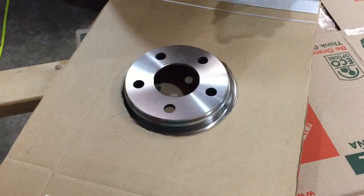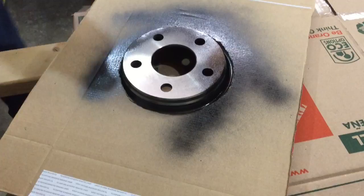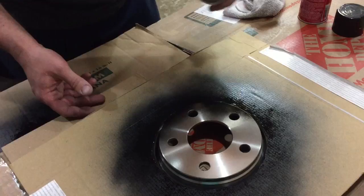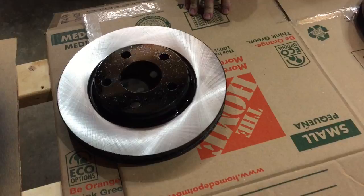The edges are painted with two coats. Now we'll lay our template right over the top of the rotor and start spraying the hubs. We've got one coat on the first rotor, so we've moved over to the second. A quick tip when painting: always keep the can moving so you don't end up getting too much in one spot and creating runs. We're putting our second and final coat on the hubs now.